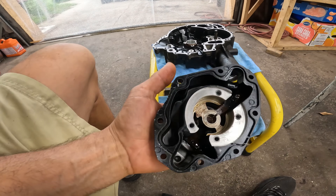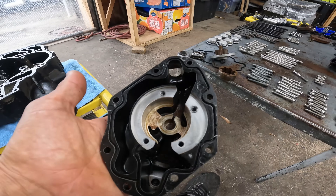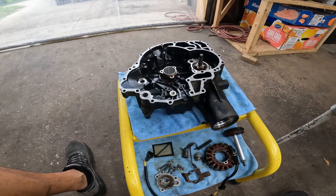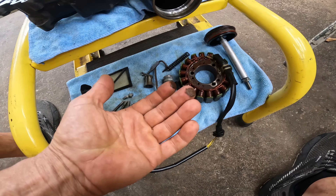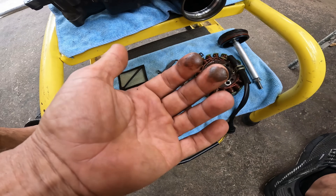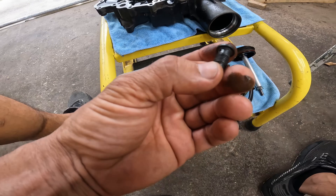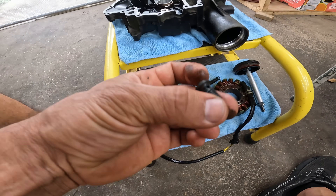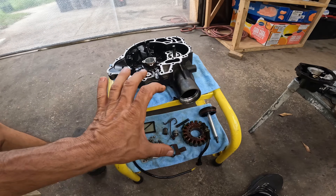All I know is that at least the motor, I'm gonna do it like I do every motor — there's not gonna be any shortcuts. As far as the oil pump goes, look at this — there's just debris in there, it's all rusty. Got to clean this. Then the PTO cover — took everything out, and you can't put this together like this. All of the stuff that's gonna be around your motor when you put it together, you gotta take everything apart, go through it, clean the squirters, make sure it's good. There's a little spring and a little ball in here — you got to make sure this is good. If it's clogged, you've got to replace it. Going through all of this, cleaning everything right, putting it back together, and then we start assembling.